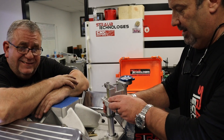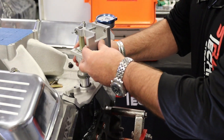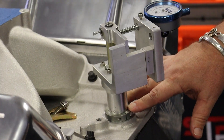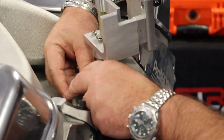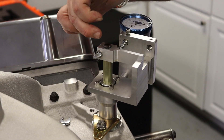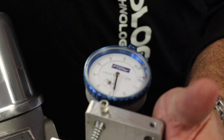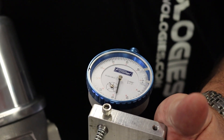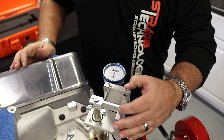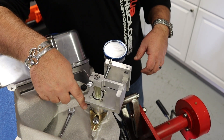We need to place the tool down in here. Remember, you are engaging the oil pump, so you have got to get this right. It just might take a little time — go back a bit, there you go. Now we're snugging. Go ahead and install your distributor clamp. This is your center line right here — you need to start on one of those arrows, it does not matter which one. So when I move this, we are checking it — we are right at about 14 thousandths. We are at 14 thousandths. We got the arrow, we got our gauge, we got our lock down.